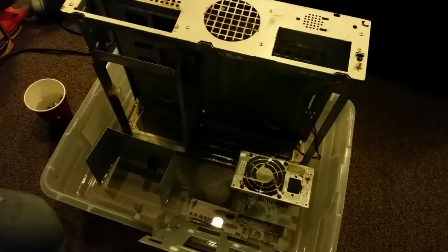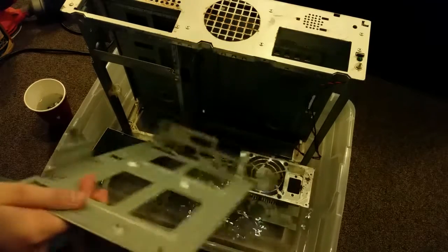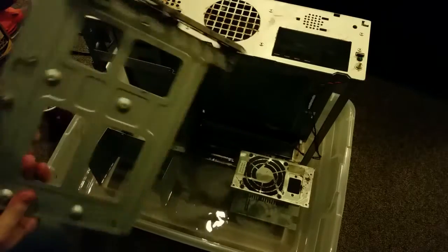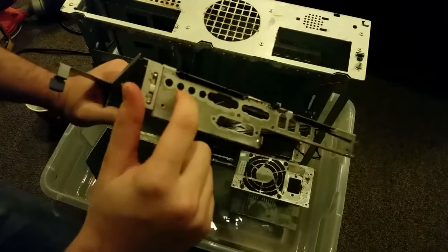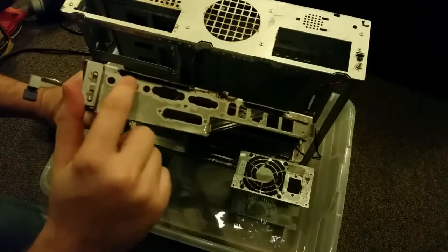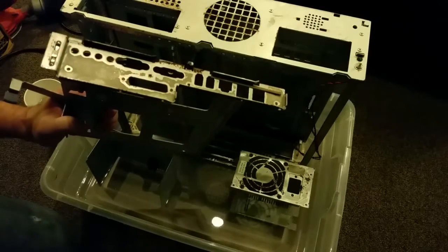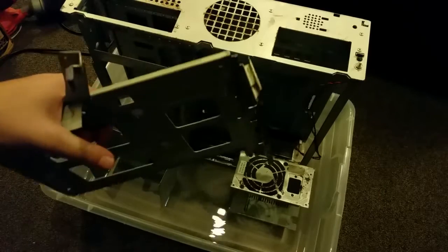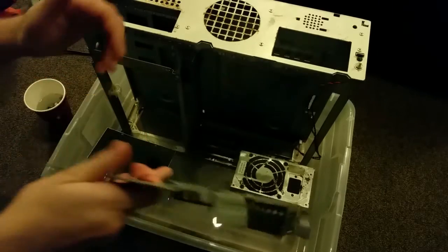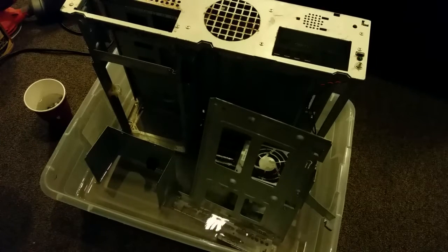All right, guys. So it's been, I don't know, probably at least an hour, letting stuff soak in the vinegar. You can see quite a big difference actually. You kind of see these outlines. That's where the rust would have been, and now it's basically perfectly clean. The vinegar will also eat away the galvanized coating on this too, so do keep that in mind. The longer you let it sit in there, it does take a while for that to happen, but it does happen eventually.